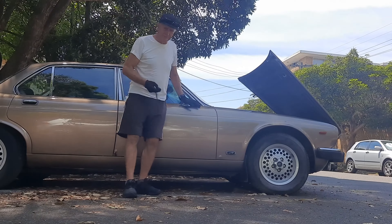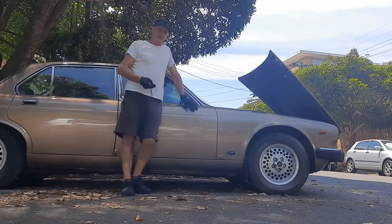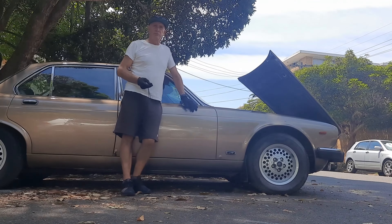It's the following day. We know we're getting fuel to the fuel rail but not to the injectors, so it's either a dirty wire somewhere, an ECU issue, or the amp has snapped.